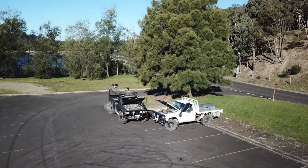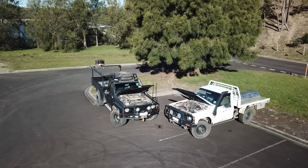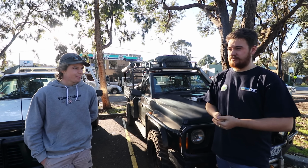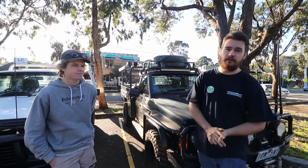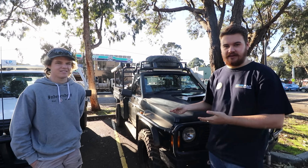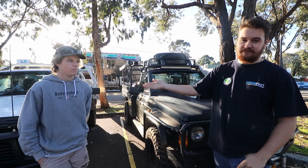So at the end of the day, should you turbo your TD42? If you've got the money and you're not planning on swapping out for like a GU or another vehicle in a couple of years, I would say definitely yes, do it. If you're really concerned about fuel economy, you can give it a good tune. You can wind your advance back and wind back the fuel screw, and it'll probably be the same fuel economy as that, if not better.